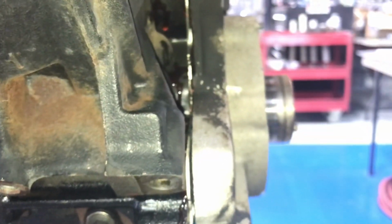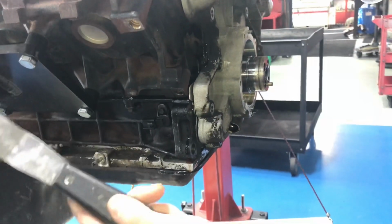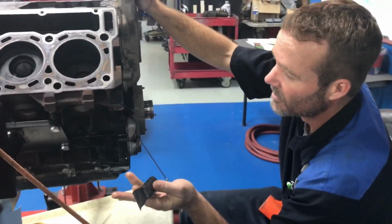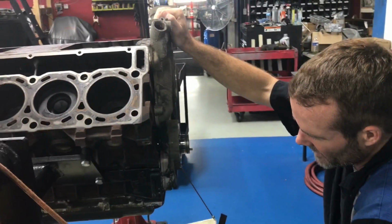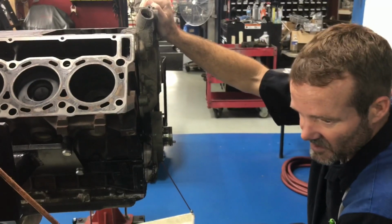Take your time. Let's not cost him a gasket, bed plate, because I used to do bed plate seals all the time. But I'm gonna tell you right now, I wanna feel the rotation of the crankshaft anytime we undo the mains. Me personally, now if you're all right with not feeling how it spins, then fine. But it's very easy to tighten all the mains and put the crank in a bind. That's easy to do. And if you're doing a bed plate and you have the connecting rod still attached to the crankshaft, then you cannot tell how hard it is to spin. You cannot tell if one got in a bind and then the crank's hard to spin. You can't tell. So lately I have been not doing bed plates unless we disconnect the connecting rods from the crankshaft, which means pistons need to come out.